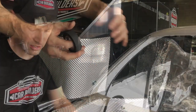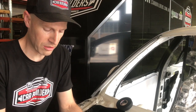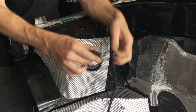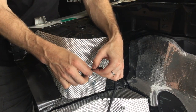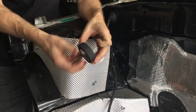The advantage with this, much like our fleece tape on the interior, is it's highly abrasion resistant. It's not a heat shielding tape, so it's good up to around 130 degrees. It's got longitudinal strength so even if you try and tear it down the grain it's not going to tear, however you can tear it across the grain. From an installation point of view, you can wrap your loom and then easily tear it — you don't actually need scissors to cut it.